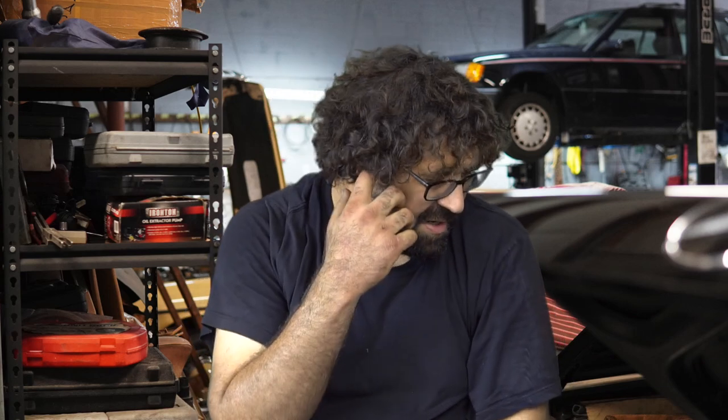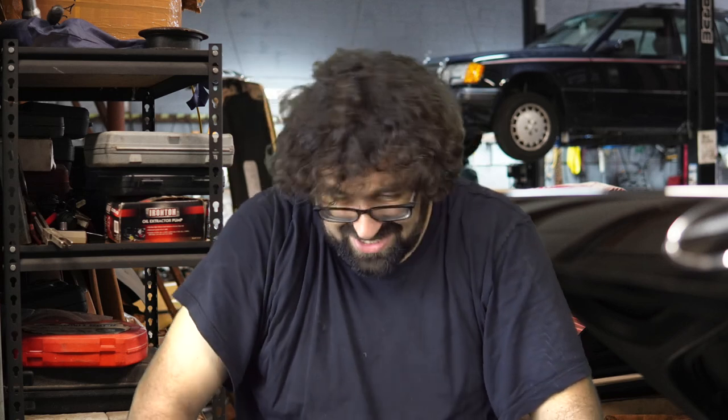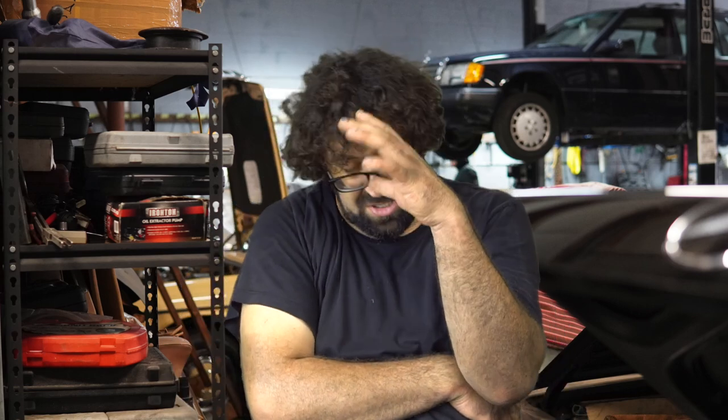We've seen a number of classic Mercedes where two or three fuel pumps have been replaced over a six-month period, and what we find is that some outside contaminant was coming in. If I were diagnosing a 1972 450SL — because that's a car where the gas tank likes to rust — and I have a history of replacing the fuel pump over and over again, the first place I'm going to go is not to the fuel pump but to the filter. I'm going to cut the filter open, and if I find rust in there, I know there may be a problem with the tank that was not addressed properly.